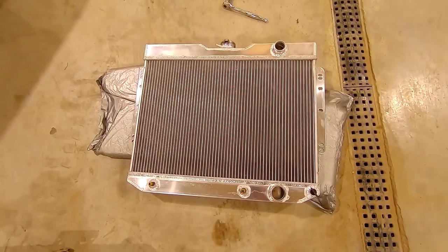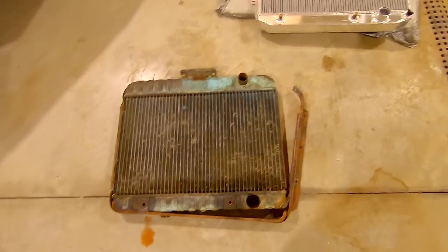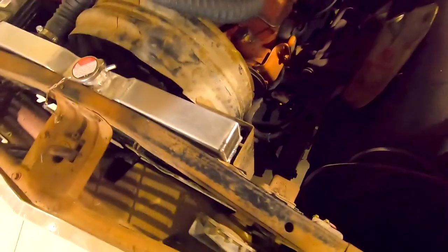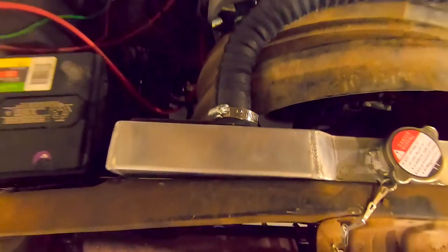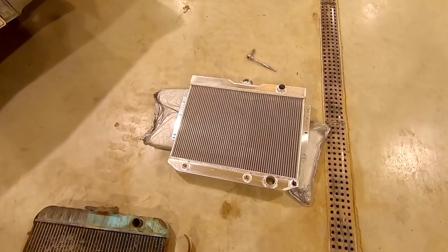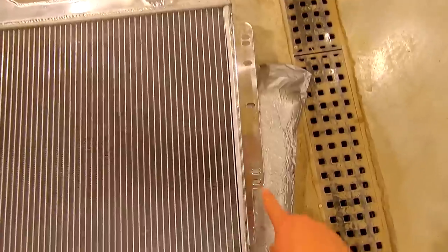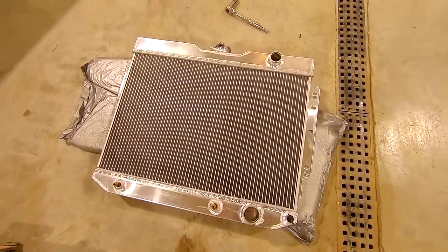This is from Black Horse Racing — it's a 59 through 64 GM three-core aluminum radiator. The two fitting holes, outlets and inlets, line up exactly, and it's a direct bolt-in. You can run a factory shroud, and if it's a V8 car, the transmission lines line right up. No reason to spend three or four hundred dollars rebuilding the original when you can get an aluminum one off eBay for 150 bucks shipped. I'm not sponsored by them, I just use these a lot. These two top holes line up pretty good; the bottom hole doesn't have quite enough mount, so you only run four screws — but I think four is sufficient.